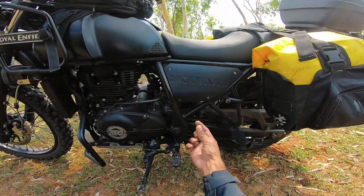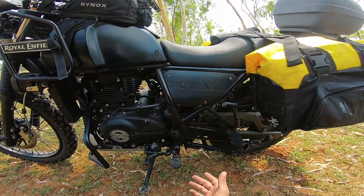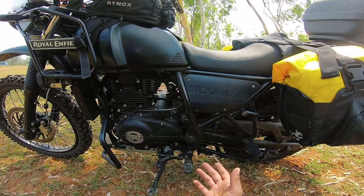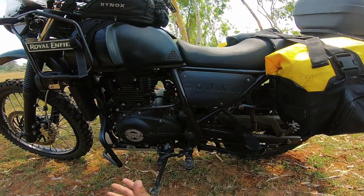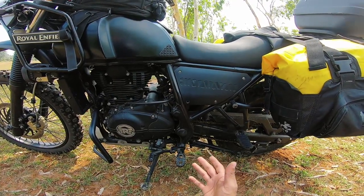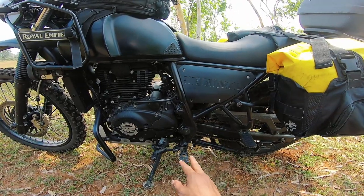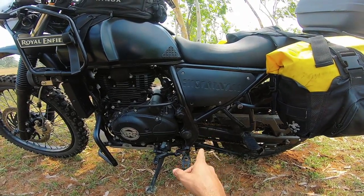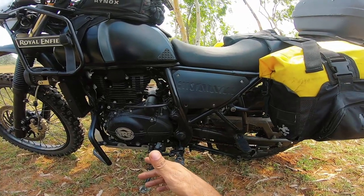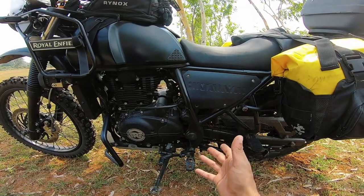That is the pitch of the chain, the width of the chain. I did some research, some reading on these RK 520 chains, and I came to know that plenty of superbikes, the big liter class bikes, have moved from a 530 or 525 to a 520. DID and RK gold chains, X-ring chains, XW-ring chains. They all say that these chains are far, far better than the ones that come from the factory.